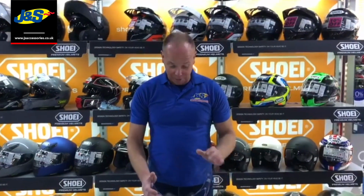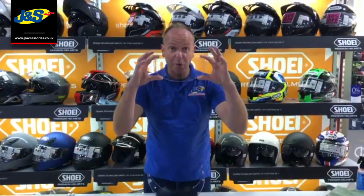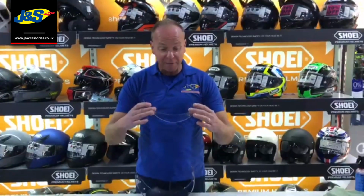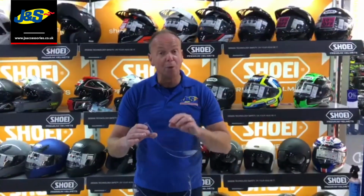Okay, to summarise, the Pinlock is a moisture absorbing material, okay? It doesn't have to be in the visor to work. If you breathe on it after drying it out and it steams up, it's goosed. You need to just go and buy a new one. If you breathe on it after you've dried it out and it's clear, it's still good to go back into the visor and continue using it, but you must dry these things out, okay?